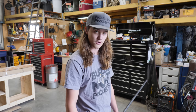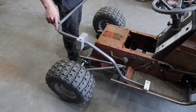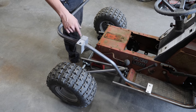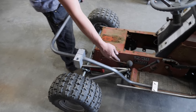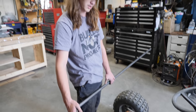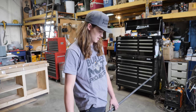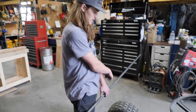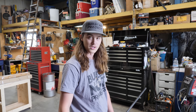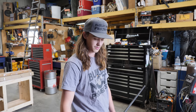So this got really complicated. A couple different bends and rotation as well, because this is angling out to get over the tire a little bit and then rotating back to get the 90-degree bend there. Now we'll see if I can replicate it down the other side and make it line up. Worst case I'll have to cut it and re-weld it to make it the right length.